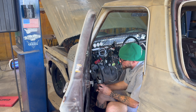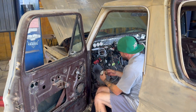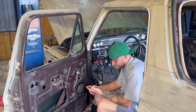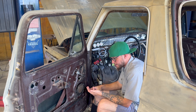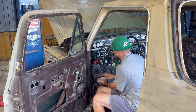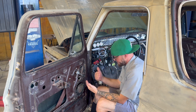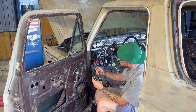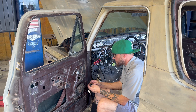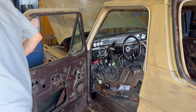So you've got ignition, battery, accessory - pretty straightforward. What I'm going to do is get my multimeter and this is the factory Crown Vic ignition switch. I'm going to put that meter on this in every position of the switch, and that'll tell me which wires are hot all the time, which wires are hot when the key's on accessory, which ones are hot on just the on position, and then I can figure out the start circuit. I'll note those wires. It's not going to be that big a deal because there's only 12 wires. Pin out the 12 wires, figure out which ones have voltage at what points - that'll tell me which ones to wire to the accessories, the ignition, and the battery. If the accessories get overloaded, I'll just wire this to a relay and let the relay power all that stuff. But it's an ignition switch, so let's get it.